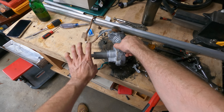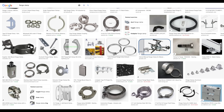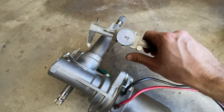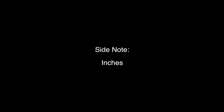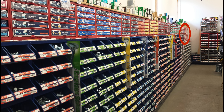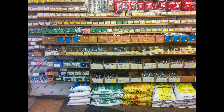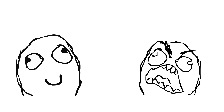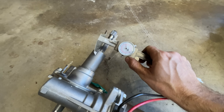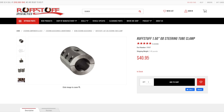I have to mount this side to the firewall. To do that, I can clamp onto it with some sort of clamp that has a flange on it — this probably doesn't exist in exactly the way I want, but I do own a welder. The sleeve right here is almost exactly 1.5 inches. I thought this was a little weird since it should be metric, but 1.5 inches is almost exactly 38 millimeters. When you're fabricating something in the United States, it's almost always easier to get fractional fasteners and materials — go to the hardware store and all the tubing, sheet metal, adapters, and fasteners are in fractions of an inch. So when you say I hate fractions, use metric like the rest of the world — rest assured that I also hate the imperial system probably more than you do, but it's just easier this way. So anyway, 1.5 inches is a good size because that will make it easier to fabricate something. All I need is a long clamp with an ID of 1.5 inches, like this one. 40 bucks — I'll take that. Then I need a flange to weld it onto.